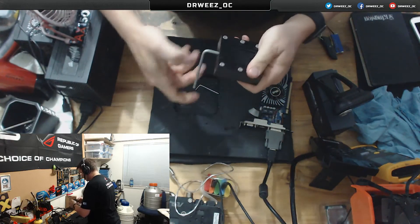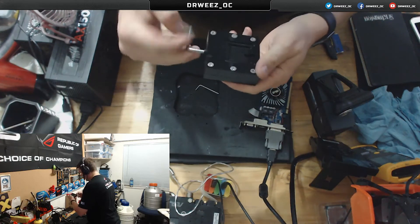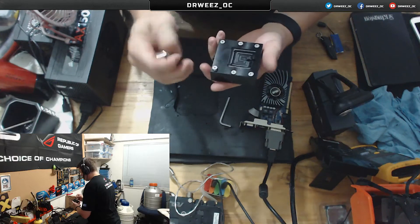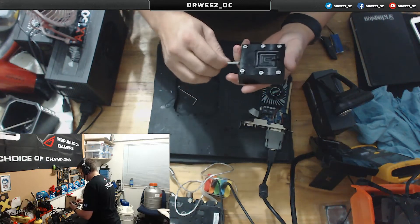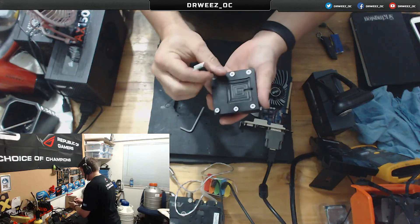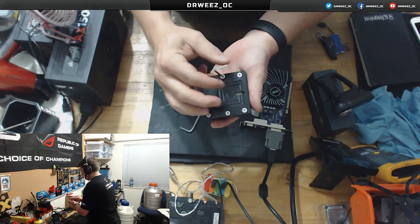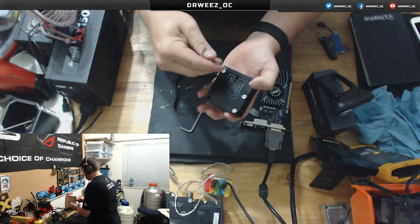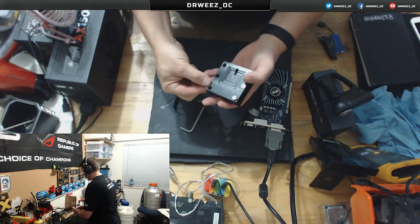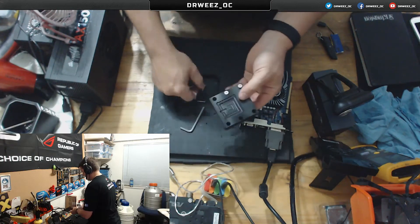I don't know if that's too far or not — wow. So I didn't hear a pop or feel a pop, but I can see that it's definitely been delidded. It does look very loose, so that's fantastic. That is a hell of a lot easier than the old razor blade method that used to take you about half an hour just to get the corners right, and then anything from another half an hour to an hour and a half, and still not get it right.